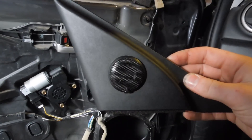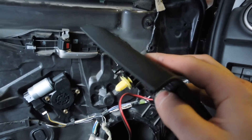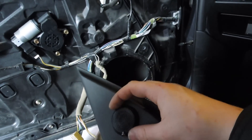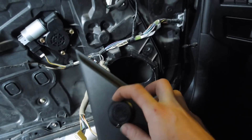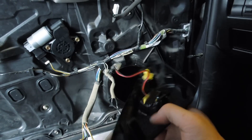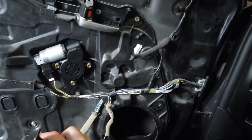What we're going to be doing now — as you can see, I've mounted the tweeter into the pillar. I didn't like how it wasn't fitting tight enough for my liking, so what I did is I added some tape and taped it through the back end. It is kind of ghetto, but it's staying in there — you're going to need a lot of pressure to pull that out. You can of course build some sort of bracket to mount into the pillar; be creative, that's the fun part of car audio. From here, you'll have wires that go from the tweeter to the crossover box, and from the mid-woofer to the crossover, and then usually two wires from there go back to the stereo unit.